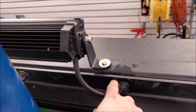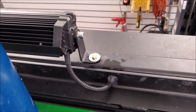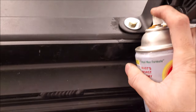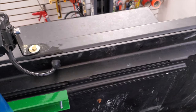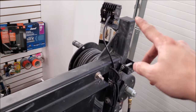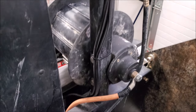What we did here is we tapped the aluminum, used quarter-20 hardware with a washer, and to finalize it — since I don't know where this thing's going to go — just a little bit of fluid film on top. Even though our hardware is plated, I want it to last as long as possible. So instead of zip-strapping or running P-clamps, we ran the wire inside the aluminum tube and came back out. For our lights out here, we ran just outside and zip-strapped everything out of the way.